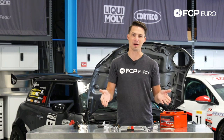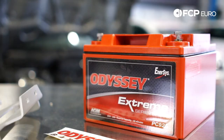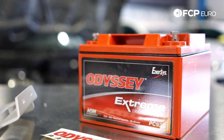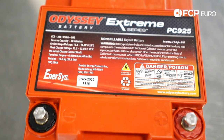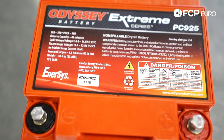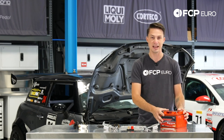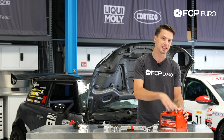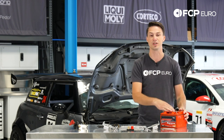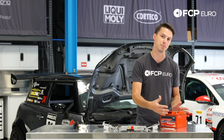Before we hop in, let's talk a little about the products in front of me. First thing is the battery — we have this Odyssey battery here. It is relatively compact, relatively light. It is an AGM battery, which means absorbed glass mat. One of the benefits of an AGM battery is they're really vibration resistant, relatively compact, and relatively light. If you're putting this inside the cabin of the car — the trunk included, if there's a pass-through — this does not need to be enclosed in a box. Whereas if you're putting a lead acid battery in the same position, it needs to be enclosed in a battery box.